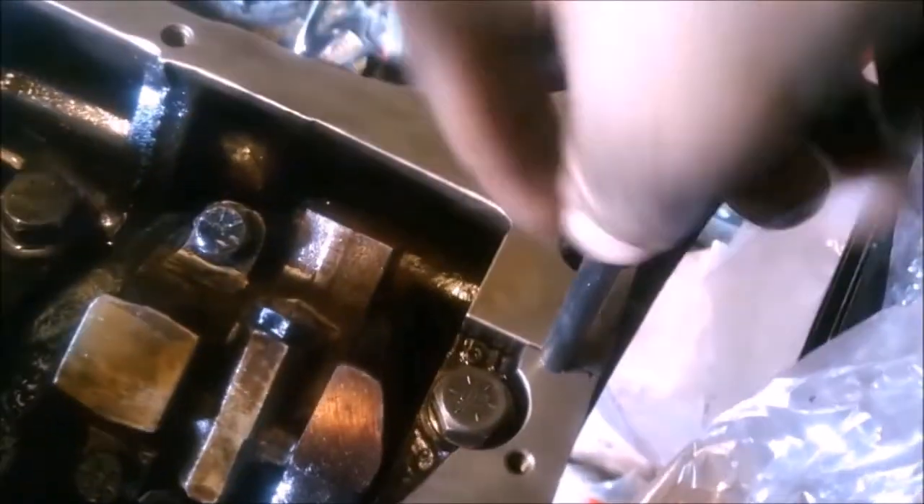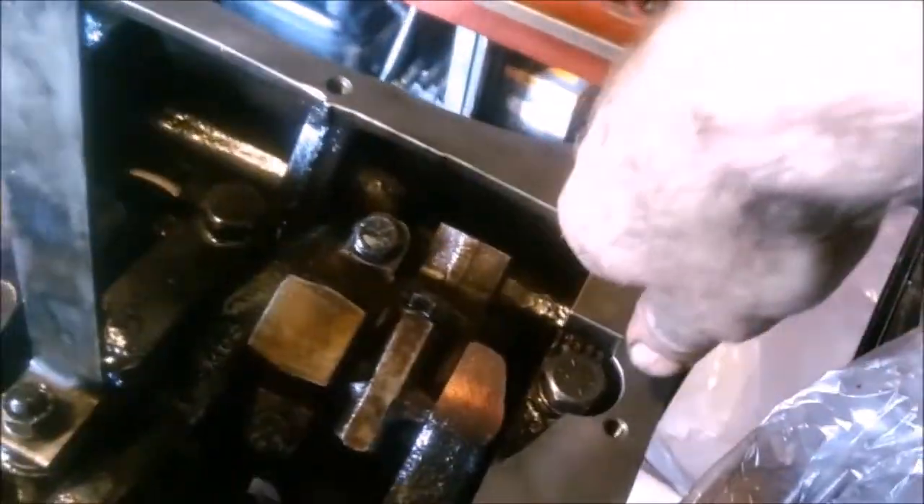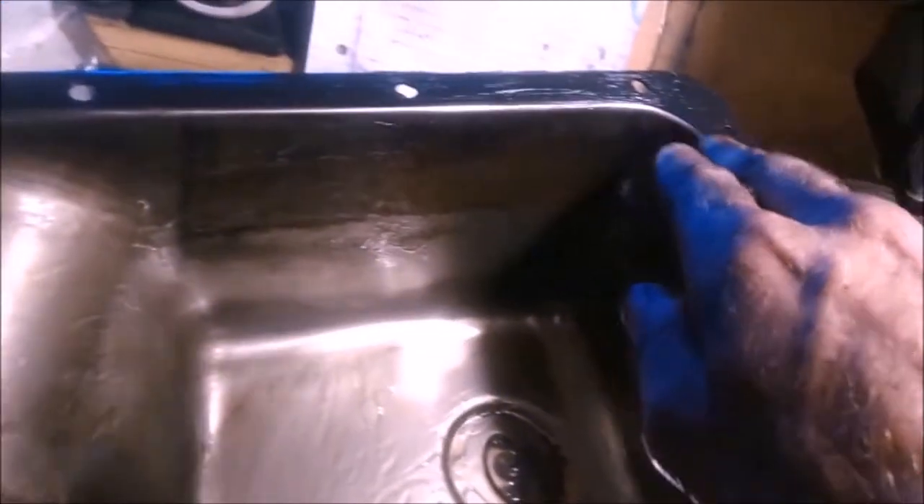Take our little plugs — we've cleaned up all the surfaces and dried them. Make sure the tool you're installing them with is smaller than the hole, otherwise suction will just keep pulling it back out. Your pan's clean, holes are clear. Wipe on a thin layer just on the pan side. I wiped a little oil on the inside of there. We want to make sure we don't have any gasket sealer seeping in there. We'll set our gasket on here.